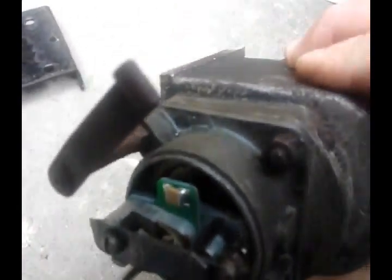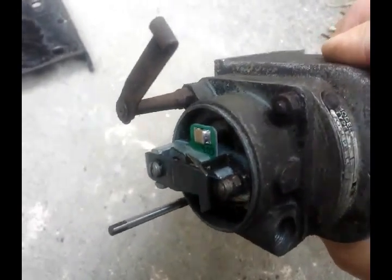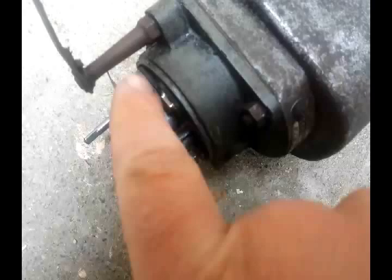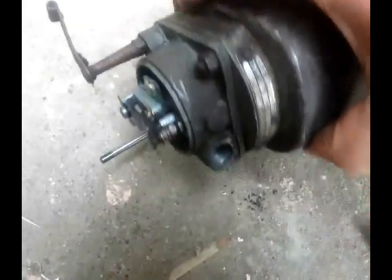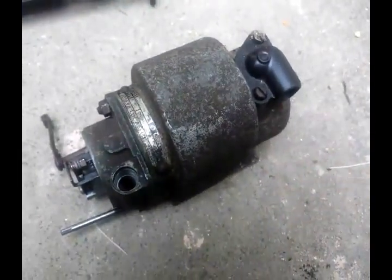I've bought one of these capacitors — this is an EasyCap, which is actually quite a nice little device. It fits in there a treat, replaces an insulator. There's normally an insulator in there, and you just literally unscrew all the contact breaker system and put it in there. I've tested this and it now sparks about 7 millimetres.